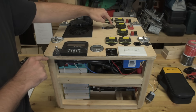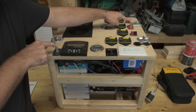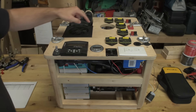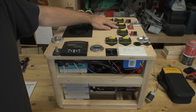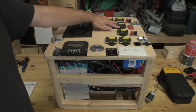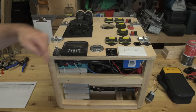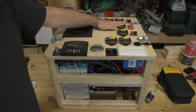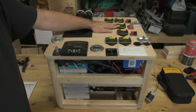This is a 12-volt system and I've got two 12-volt battery terminal posts — these are three-eighths inch posts. These are full power, full amperage, so whatever I can get out of the battery will go through that. I've got a 150-amp breaker on the entire system. I've got a 220-amp low voltage disconnect down inside the case — it's also a Victron unit, a BP 220 Battery Protect. Whatever will go through this 150-amp breaker will power these two posts here.